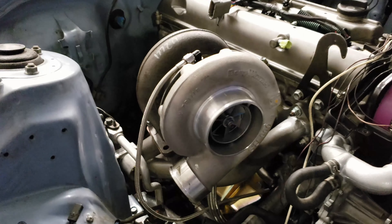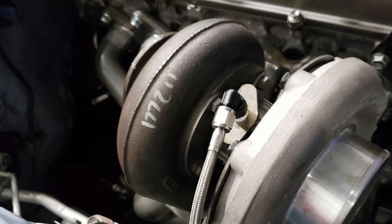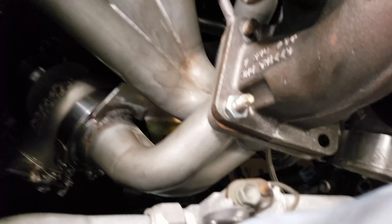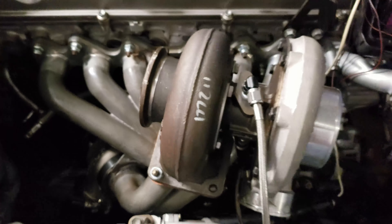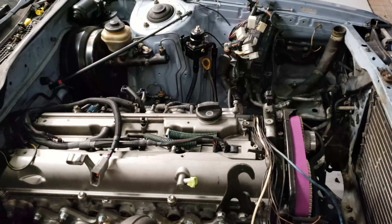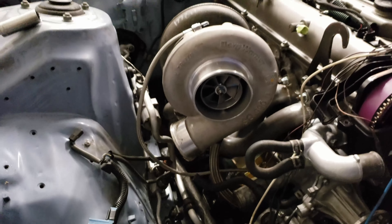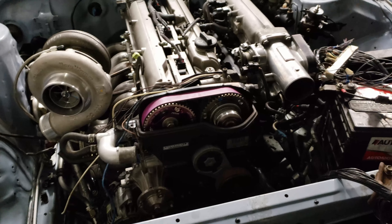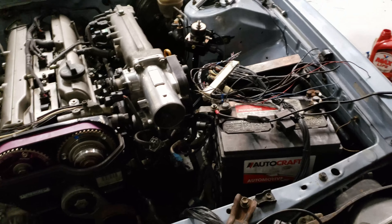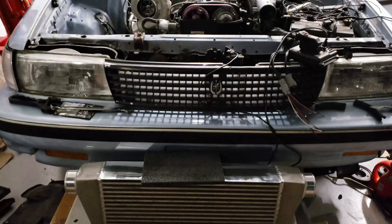Turbo on, feed fitting tightened, feed line tightened, drain tightened — all that stuff. Except for some reason I'm missing the bag with nuts and washers to hold it on, so I'll have to go to Ace and grab those. I had that on my list. This side is done. I can get started on the wiring on that side now. Clocked the turbo housing — going to put a 90-degree on it and then run the intercooler piping. Tried to start the car, kept getting some little popping, wouldn't quite start — I think the battery is low. Kind of tired of messing with the wiring so I'm going to clean up and work on getting the bumper off so I can start with the intercooler.